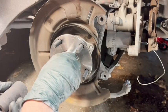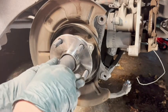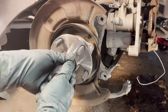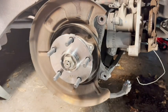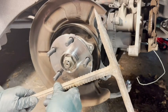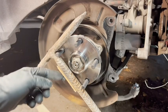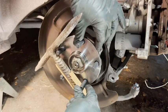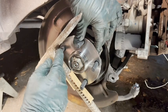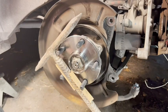Now we're going to get this nut tightened down using our big 32 millimeter socket and torque it to 177 foot-pounds. This time, instead of letting the bar rest against the nice new nuts, I'm going to put some small pieces of wood there to cushion the blow. When I tighten this down, the bolts will press against the wood rather than the bar, so it does not damage the threads on the bolts.